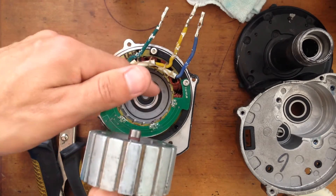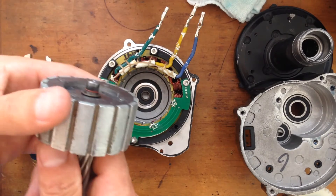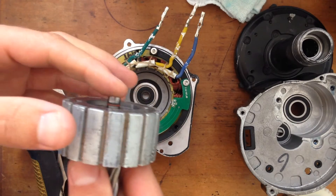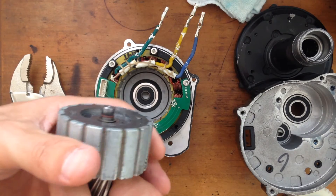If the O-ring is missing, the shaft is probably going wobbly inside the bearing and the retaining compound might not be enough to fix the problem. Make sure there are no scratches along the neodymium magnet, because if it was going wobbly it would be touching the motor — and that's when you get the knocking sound, bang bang bang.